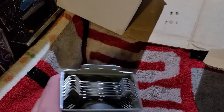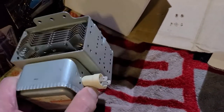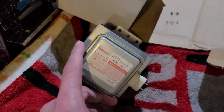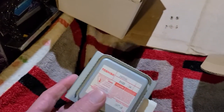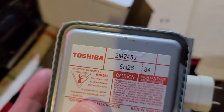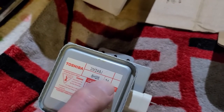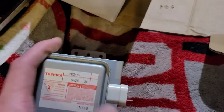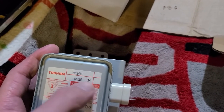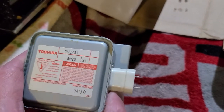This is about 4 days later because I had to order one of these online. I picked this magnetron up for 60 bucks online — this is the old magnetron, you can't even tell anything is wrong with it. The new magnetron is the same model number and everything. With the exception of some batch coding numbers — like the 5H20, that's a batch code for when they make these. But the model number is the same.